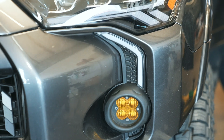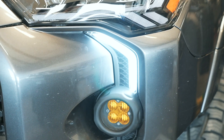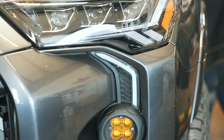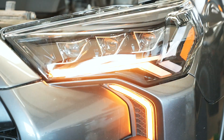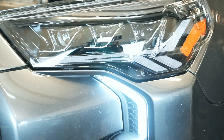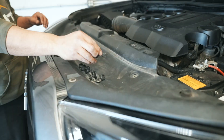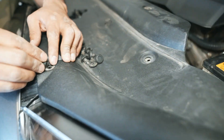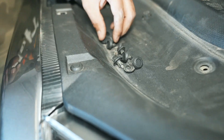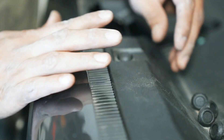Now we're going to turn it on and test them out. That's the white, and that is the turn signal. As you guys can see, this is the switchback version — it'll blink with the turn signals, and when the vehicle is just on, it is white. Now you can put the cowl back on, line it up with all these rubber feet, and with these clips you will need to pop them back up and then feed it into the holes and push it down so that way it's flush.